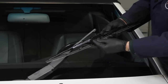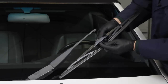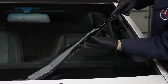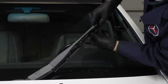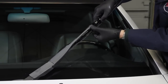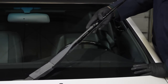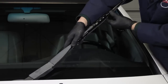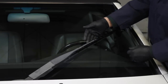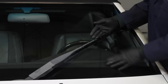Taking the new Bosch wiper blade assembly, I'll begin by pushing the snap down. You'll have to get it all the way down in position as you see here, then take the blade, stick it under the arm, move it back, and drop that hook into place, pull forward, and then bring the snap up until it's locked in place. There's no way that wiper is going to come off the arm. Then you can take the arm and just with a light quick snap, position it back down on the windshield.